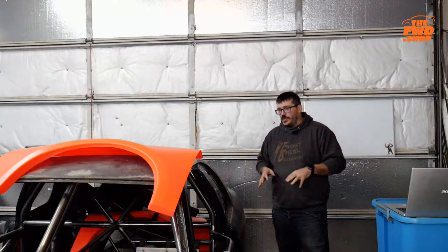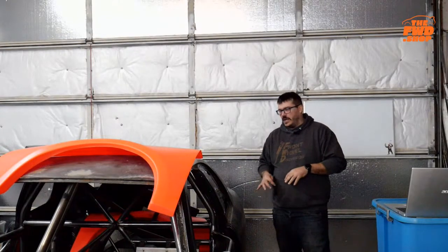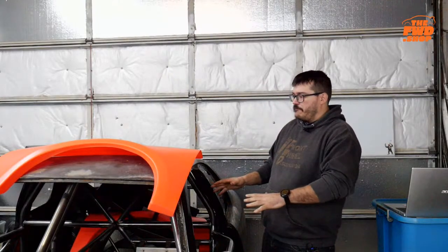What I see a lot of people do when they're building a new car is they bring it in, they strip it, they start just cutting all the sheet metal out of it that they think they should, however they think they should, and then they just toss a cage in it, and then they just adapt everything to that. The plan that you have, you need to actually sit down and figure out what all you are going to do to the car you're building.